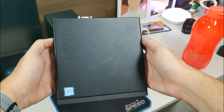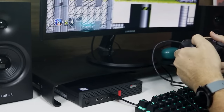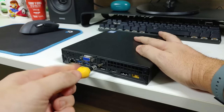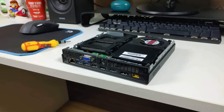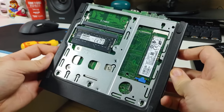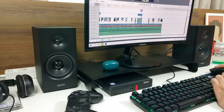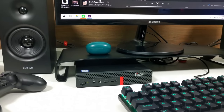The large air vents at the back keep the CPU and system cool without creating a lot of noise. There are a wide range of CPU, RAM, and storage configurations available for this model, with the highest-end version being an Intel i7-8700T with a 1TB SSD and 32 GB RAM. With one screw removed at the back, you can slide the top and front off to access the inside, where you'll see the empty 2.5-inch storage bay for a SATA SSD or HDD. Since it is a business device, it comes with many perks IT managers will love, like the Lenovo Vantage software. Security is another strength, with smart USB protection allowing network administrators to control what USB devices can connect to its ports.